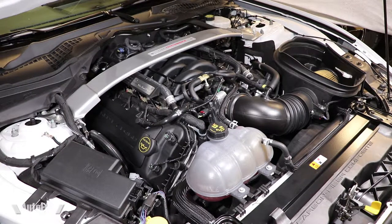The ideal oil separator setup for a GT350 is two oil separators — one located on the driver's side and one on the passenger side. The passenger side seems to be the one that will collect most of the oil, and I will definitely prioritize it over the driver's side if on a budget.